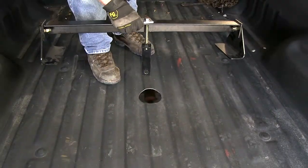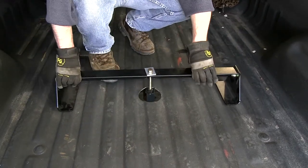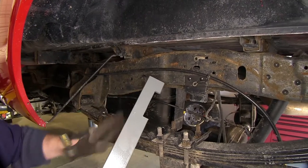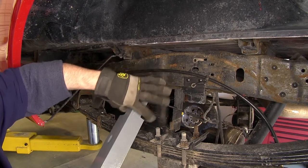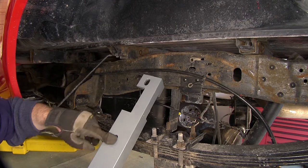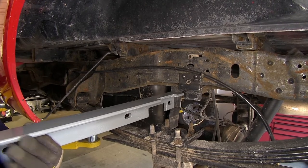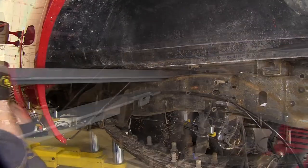We're going to go ahead and put our support apparatus in place now so that once we get to the point of putting the center section up into position, we can use this to help support it as we bolt the center section to each of the cross rails. Now we're going to begin by installing the rear cross piece. You'll notice there are two notches taken out on this one — these two notches will end up at the passenger side rear. There are also oval holes drilled in it, and these will face forward when the bracket is flipped forward. Now we'll go ahead and install it from the driver's side, sliding it across and then flipping it up into position.